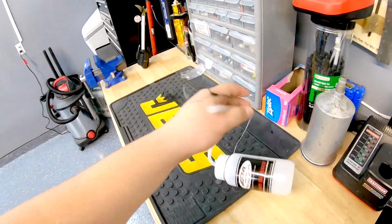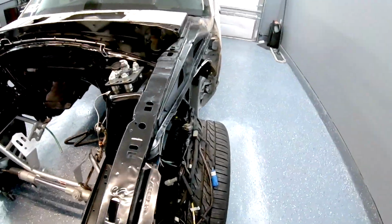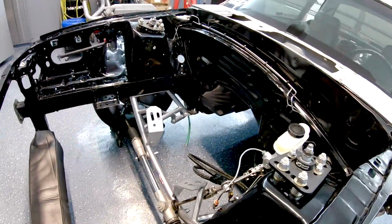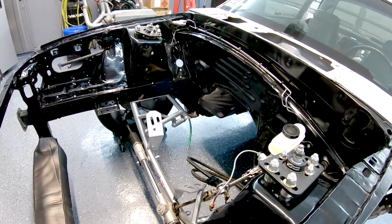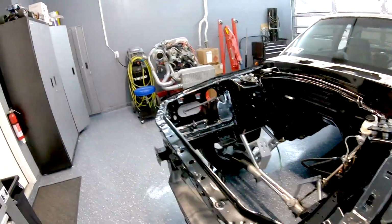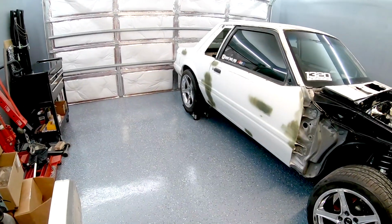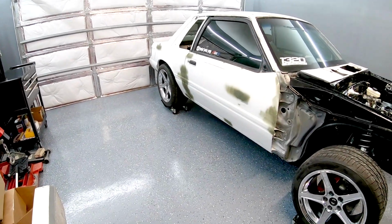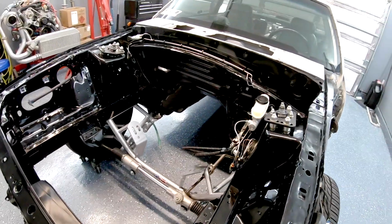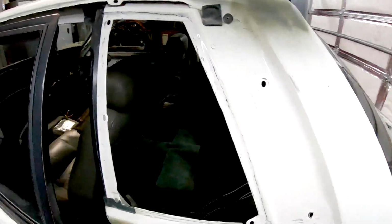At the same time, you got to remember to keep the tank pressurized to at least 15 pounds. That way you have fluid in there. You got to make sure you have fluid in there, and then that way there's always pressure in the lines to push all the air down and out of the calipers. So I did it 2 times around, and after that it seemed pretty good. It didn't seem like there was a lot of air, but having that pressure tank push out the air helps out a lot, and it makes bleeding a lot faster.